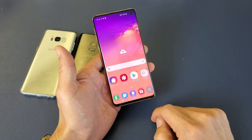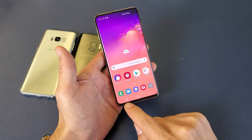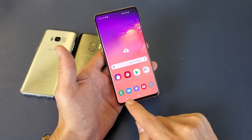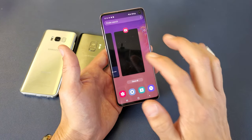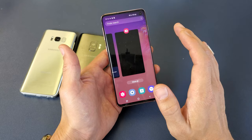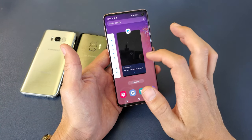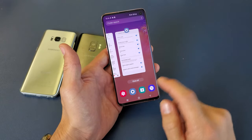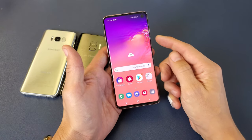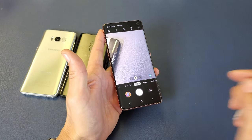The first thing — go ahead and open your recent apps. Tap on the bottom-left recent apps icon, the three vertical lines. These are all your background running apps. You want to close all of them because it's possible that one of these apps is interfering with the camera. Swipe up to close them, or tap 'Close All' to close them all at once. Open up your camera and hopefully the issue is gone; if not, go to step two.